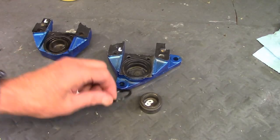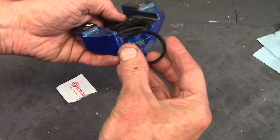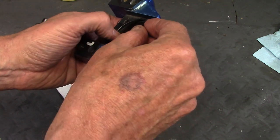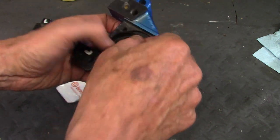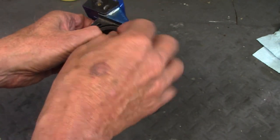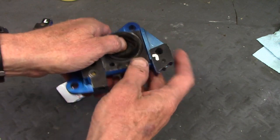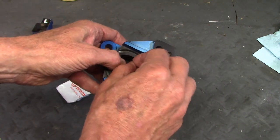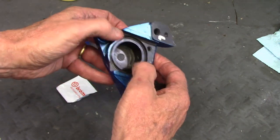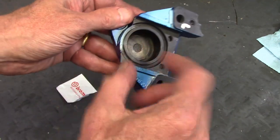I'm ready to put the square O-ring into one half of the caliper. It's not hard to do — just catch it in the groove and work your way around keeping it in the groove with your finger and it'll eventually pop in. It wants to fold over on itself a little bit at the very end, but it goes in all nice and smooth.